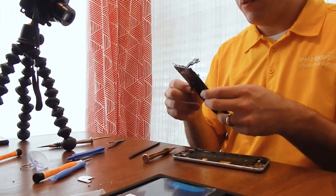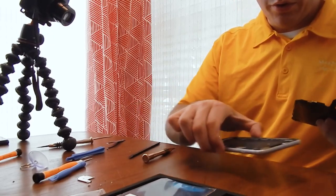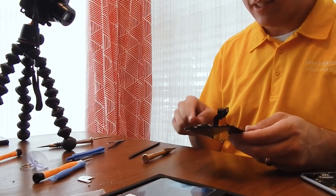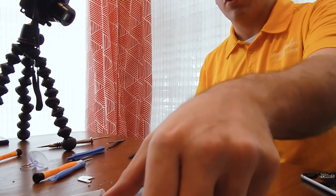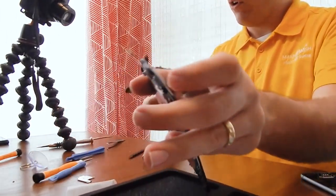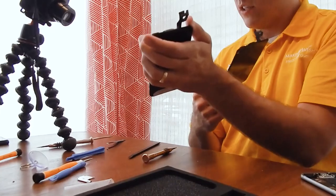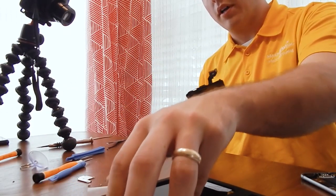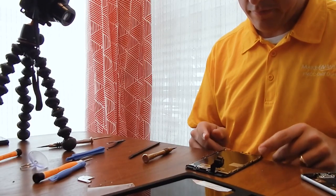And for anybody who was freaked out by Apple security, one cool thing about Touch ID is literally the home button that came on your original phone had to stay there. So this home button on this new screen will work, but just to go back home. I'm going to have to take the home button off the original and swap it onto the new glass to make sure that my friend's iPhone home button Touch ID will work. Next thing.